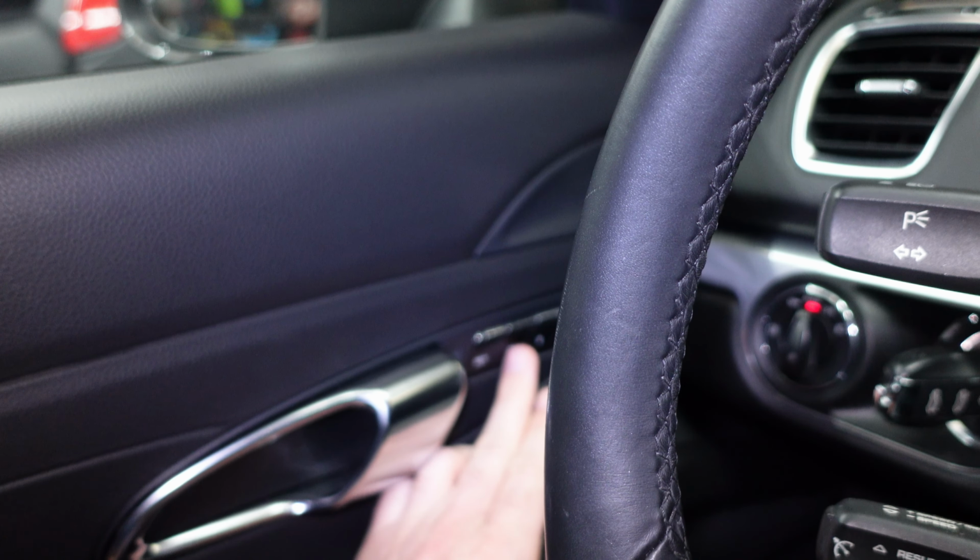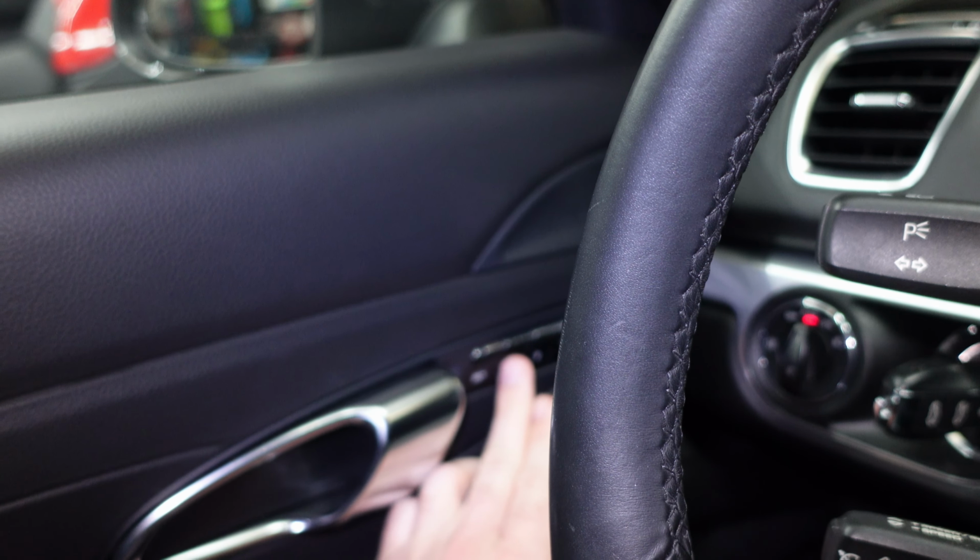And then once we've done that, we're going to come back over and press and hold the 1 button. Then as we get the car up to about 5 miles an hour, it should auto tilt back up to where it was before, and we'll recheck it to see if the memory holds and if it does act the way it's supposed to act.